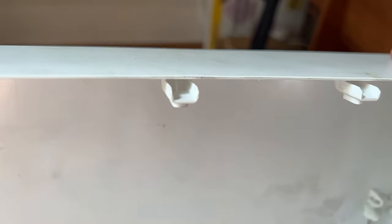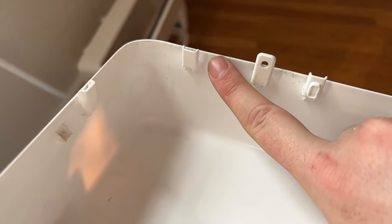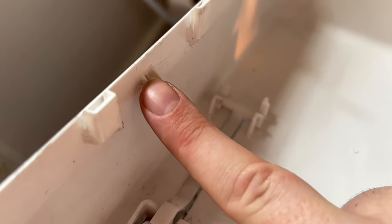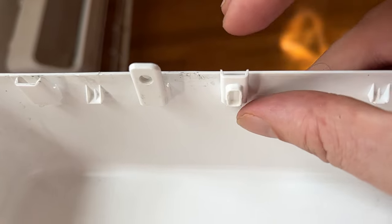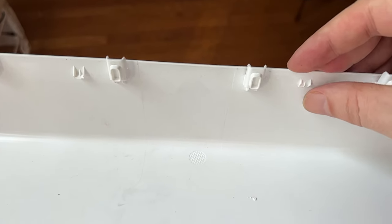See, here's a closer look at the hooks. This side goes up above and next to this, and they just all hook into each other. Once you've done this a bunch, it comes off really easy. Like now, I've gotten this first one off, it's just kind of popping apart. Just to show you how the plastic goes on. So you see these hooks here, and people think, oh, well, they don't align with the plastic hooks on the front end. They're not supposed to. The plastic hooks on the front end go into these hooks here that are all around. So you think, oh, should I guide it onto this? No, this just guides everything else in. It's these hooks that you're trying to separate the hooks of the front end from.